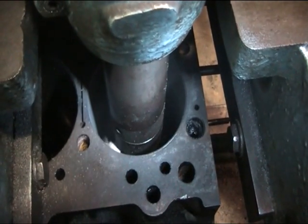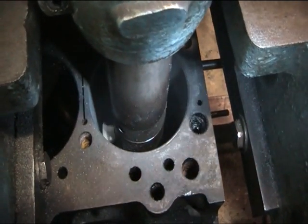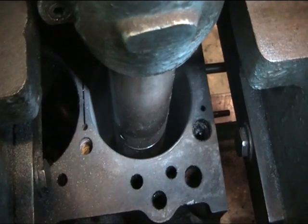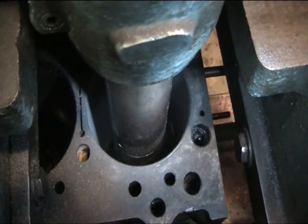We like to take it nice and evenly, a nice smooth cut. When the cylinders are cut, the honing process only takes a small while — we maybe take another two to three thousandths out with the honing stones to get the correct fit and the running clearance for the pistons.